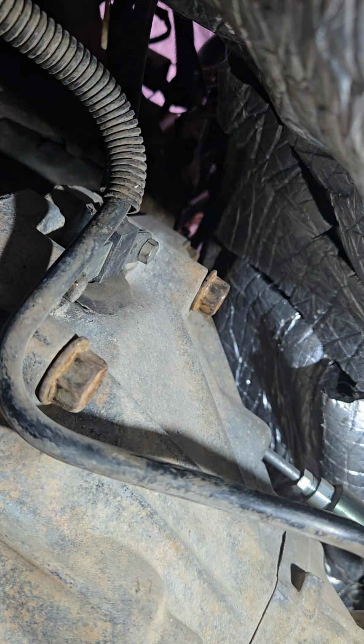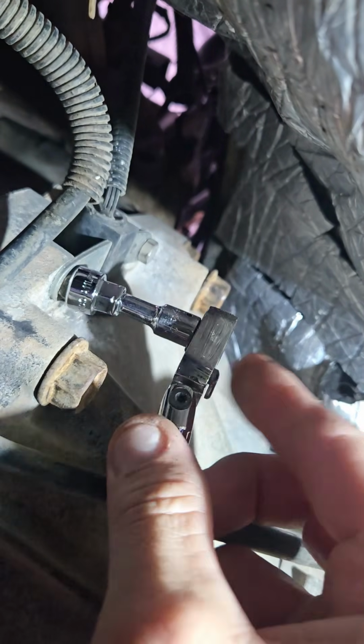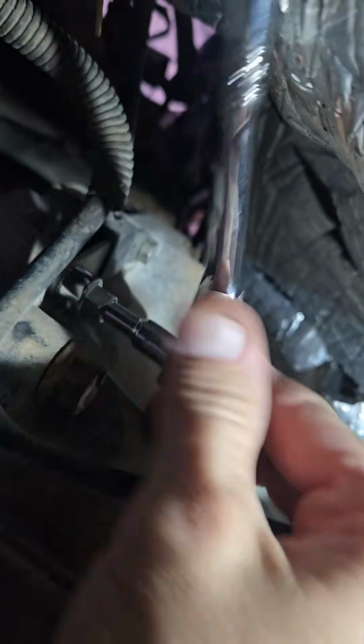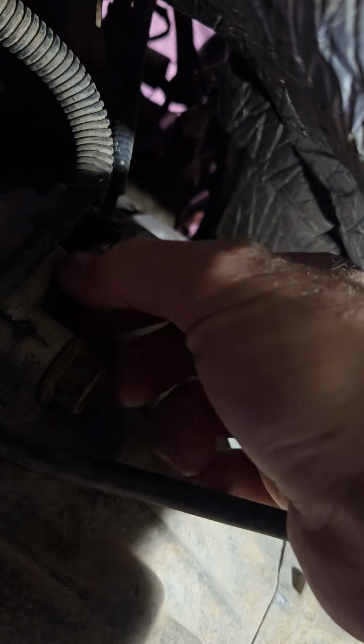Yeah, and working around that clutch line was kind of annoying. So good I was down here actually changing this part out, because I found out that that clutch line was rubbing on the bell housing down there next to that very bottom bolt, and came back. I put some fiber tape around it, made sure that I was safe from chafing and don't wind up losing my clutch.